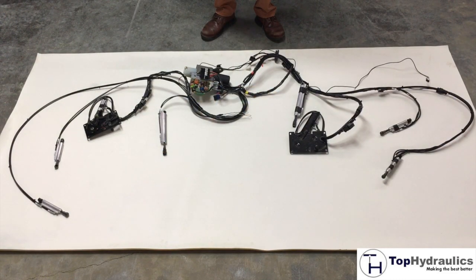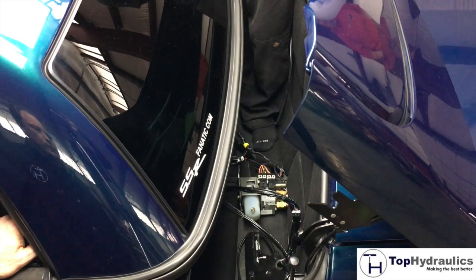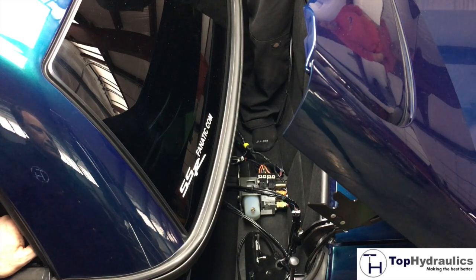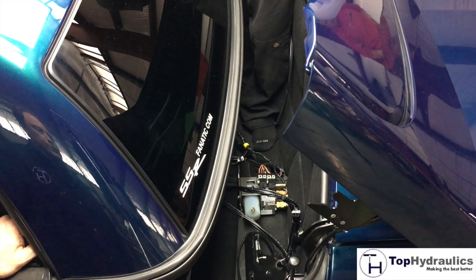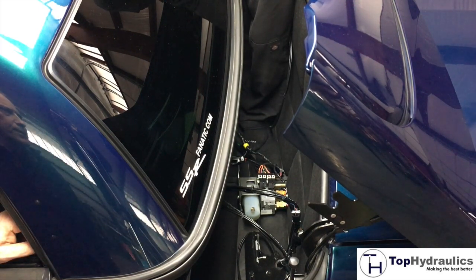Next, we will show you how to swap this system into your SSR. Here we have the new hydraulic system put into the storage compartment next to the old one. A person can still easily stand inside the storage compartment and it is not that difficult to get at the points where everything gets screwed in or attached. We are swapping the system piece by piece — taking out one cylinder and putting in the replacement, then the next one and so forth. Starting with the tonneau cover extension cylinder, then moving on to the tonneau cover lift cylinder, the tonneau cover locks, the main lift cylinders, and lastly the pump. We will show you this step by step.